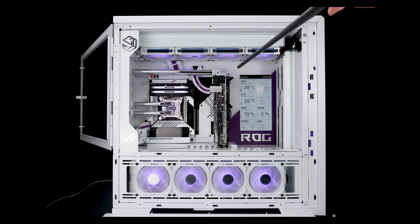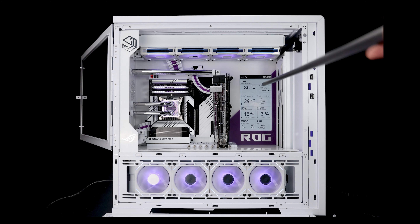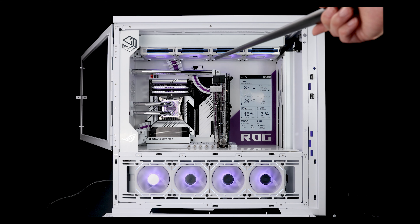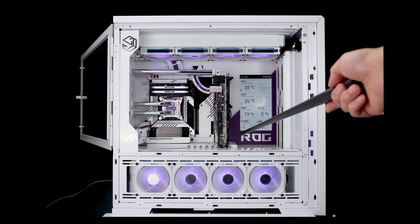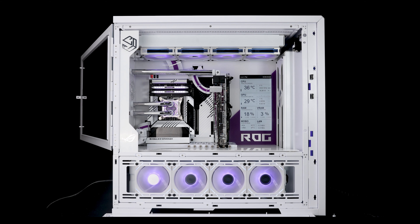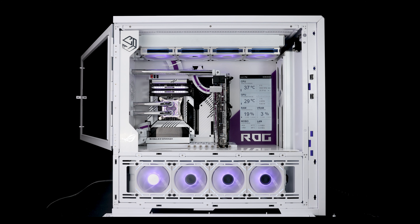When you rotate this motherboard, the mainboard tray's back plate sticks out about five millimeters — a little more than five. With the screen recessed and this plastic cover I made around the motherboard — where I measured every single cutout and designed the holes for cables to go through, about 12 millimeters up — I cut all of this on my CNC. It's a lot easier than doing it by hand. I've done it by hand before and it's a pain. On the CNC it's so much easier, though I did have to remake it three or four times to get it exactly right.